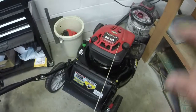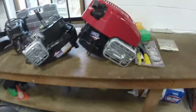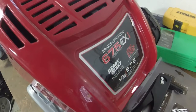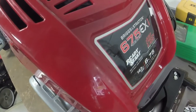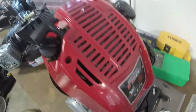The Quantum at 190cc was the direct replacement engine you'd find on this type of lawnmower up until about 2013 to 2014. When they switched over, the new style is the 675 EXi series overhead valve — and you only have 163cc now. Remember the basic 450 series had 148cc on a basic push mower, so you're only talking about about 15 more cc's difference between the old 450 and the new 675 EXi — and that's a 27cc difference between the old Quantum and the new 675s. These do still have some power behind them, but they still pale in comparison to the old Quantums.